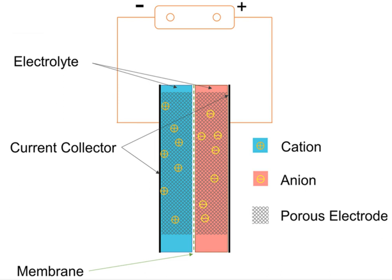Supercapacitor–battery combinations in electric vehicles (EV) and hybrid electric vehicles (HEV) are well investigated. A 20 to 60% fuel reduction has been claimed by recovering brake energy in EVs or HEVs. The ability of supercapacitors to charge much faster than batteries, their stable electrical properties, broader temperature range and longer lifetime are suitable, but weight, volume and especially cost mitigate those advantages. Supercapacitors' lower specific energy makes them unsuitable for use as a standalone energy source for long-distance driving.